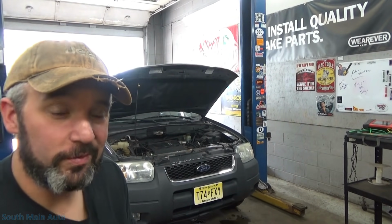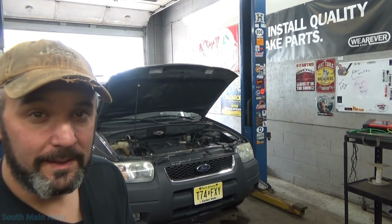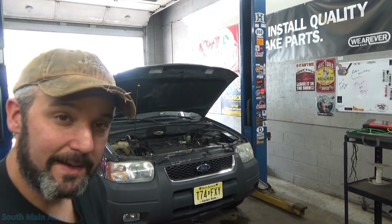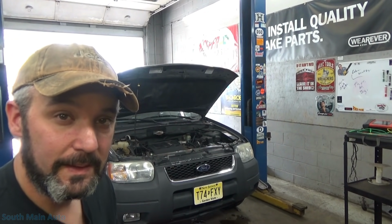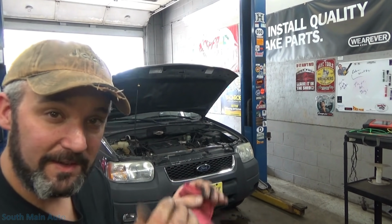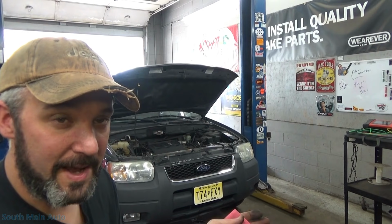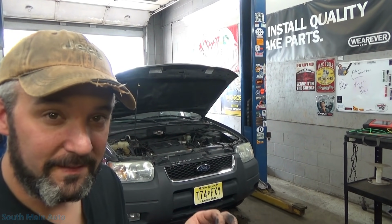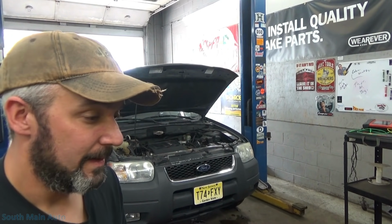Folks, lunch is over, and after some contemplating, there are a couple things that I don't like. I don't like the fact that it doesn't drop out with the sensor unplugged or with another substituted value. Hitting it with a test light to change the value, removing the sensor from the equation, it's happy. For some reason, I think the sensor is going wonky.